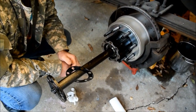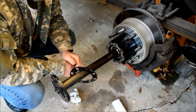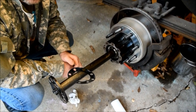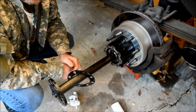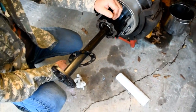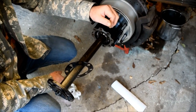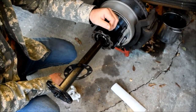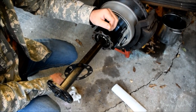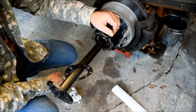I got another how-to to come out on a different transmission that's bigger, which is a 4R100, and that covers the E40D and all of its variants, and you could even take it into the C6, where it came from. So I have another one on the 4R70. You can call it 4R70, 4R75, 4R75E, 4R75W, the beefed up version of the 4R70, which is just a variant of the AOD, the Ford AOD transmission.